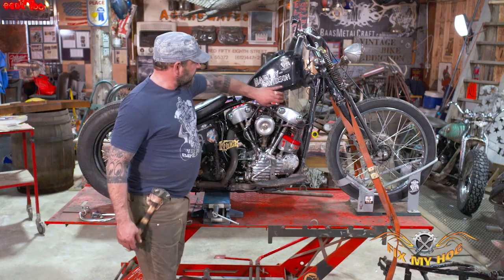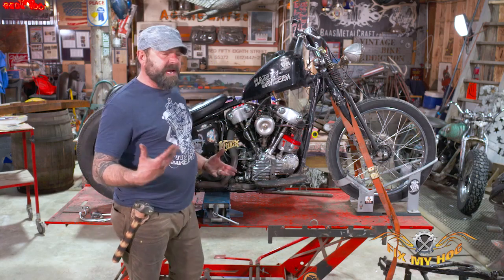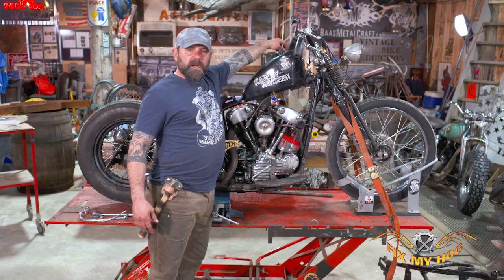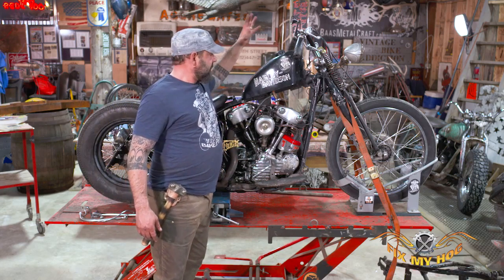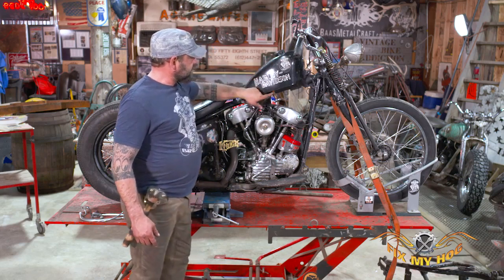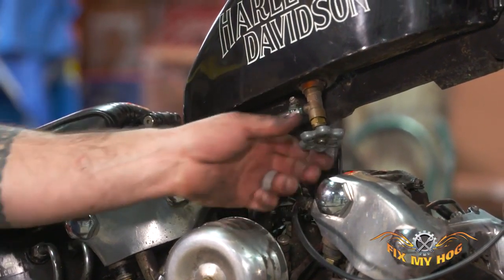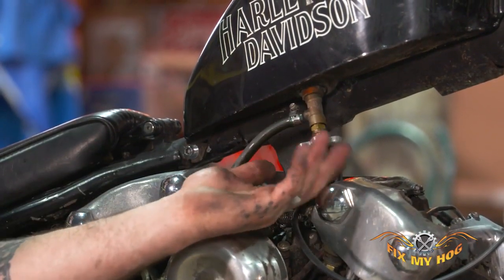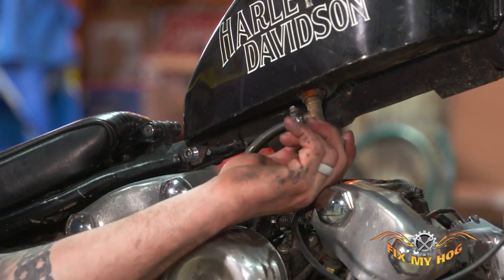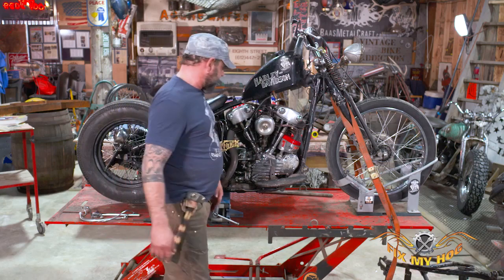To start, make sure your petcock is turned off. Everybody's going to have different stuff on their bikes depending on what you have. If it's a stock-style knucklehead gas tank, you'll have a petcock that goes through the gas tank. In this case, this is an old peanut tank — kind of a chopper addition. It's got a petcock down here that's not a traditional style; this is a spigot, almost like a faucet for a garden hose. I just want to make sure that's all the way in and tight so that when I pull this gas line, all my gas doesn't drain out all over the place.